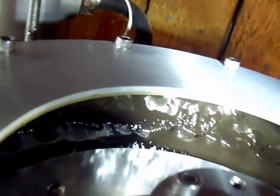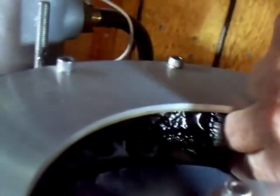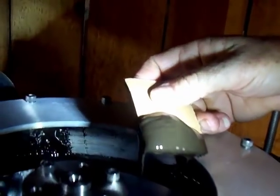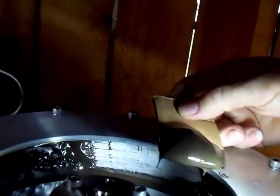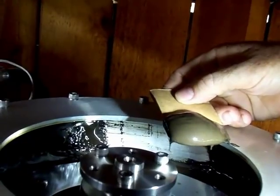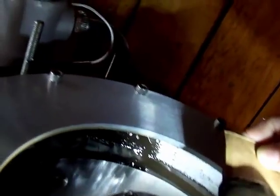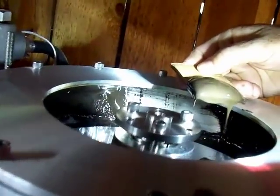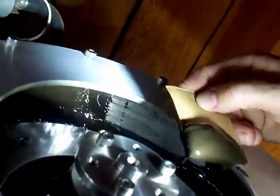You can see a little bit of antifreeze and stuff oozing out of it. I'm going to grab a piece of cardboard and scrape some of this stuff so you can see just how nasty it is. That's a nasty soupy sludge — that's what we get out after it's been settled. We got a couple gallons of liquid sludge out too. This is stuff like oil additives, it could be dirt, carbon from the fuel, and things like zinc and calcium that they put in oil — that's the harder stuff in there. And you can see we got plenty of this goop out in the centrifuge.